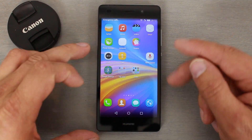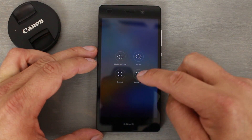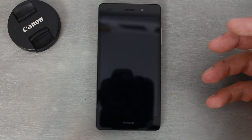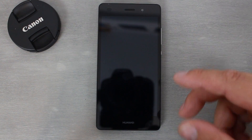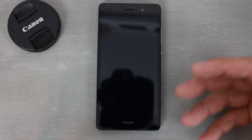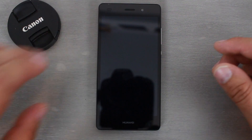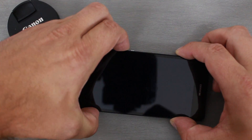If you've got your stuff set up, that's pretty much it. First thing you do is power off the device — this is the Huawei P8 Lite. What happens is you're going to boot into a recovery mode that will automatically start flashing the firmware restore. Note: this device was rooted and had some customization — that's all going to be gone. If your device is in a boot loop or bricked, you can pull your SD card, put the firmware on there, slide it in, and do the same thing.